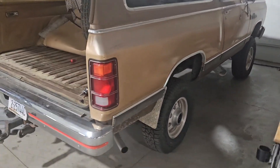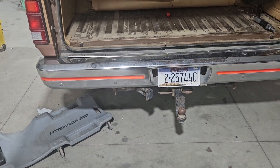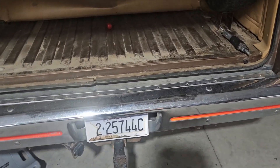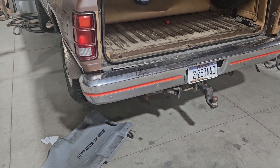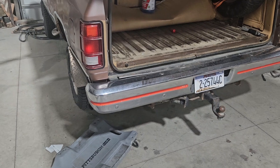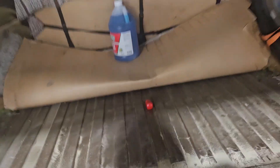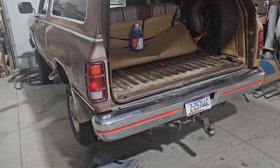The sending unit is not working. I spent a few minutes laying underneath to drop the fuel tank, but it has a metal skid plate with a hitch and bolts that are so rusty. The metal skid plate that holds the tank on looks like it's going to break bolts. Looking up through there, you can see the strap bolts are corroded and pitted. It's going to be a lot of work just to drop that fuel tank to fix a fuel gauge.